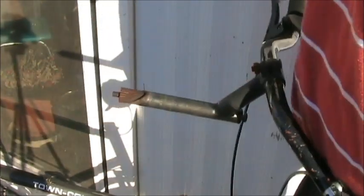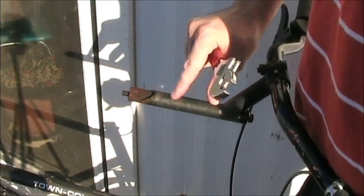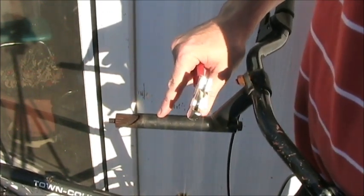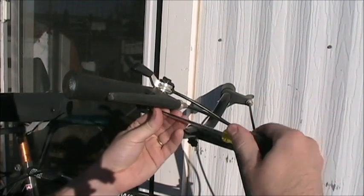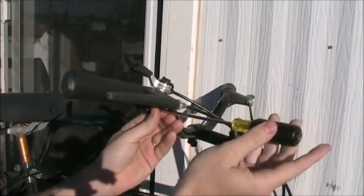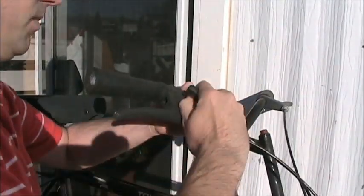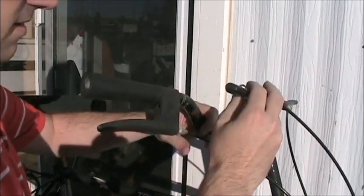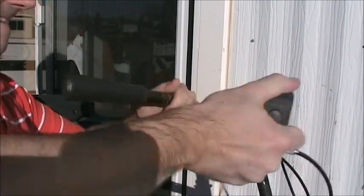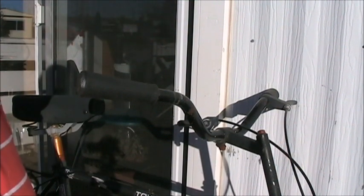Notice there's a minimum level of insertion right here — it was inserted way down here, so it wasn't even in far enough. So when we return it, we'll put it back to its highest level that it will accommodate. Brakes are easy enough. There's just a screw underneath here that clamps it to the handlebar. Just release it. So I just undid both bolts — I think I can open it up enough to actually get it off. There's the shifter. There's the brake. Do the other side, and then we'll actually move the handlebars around.